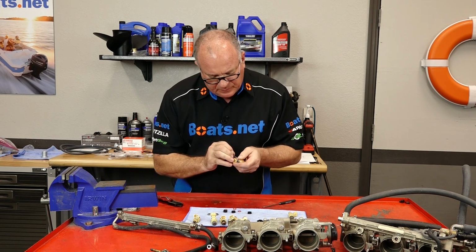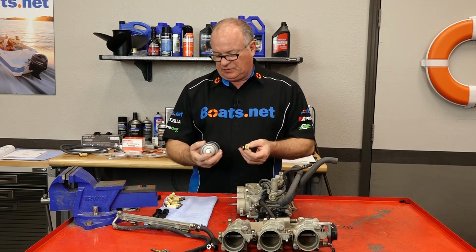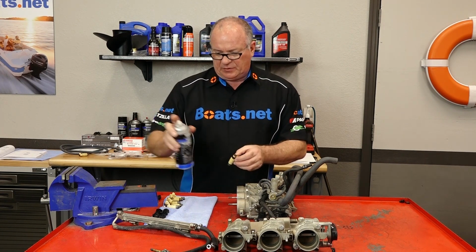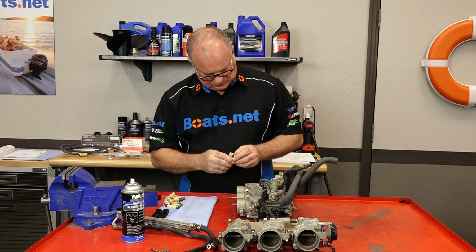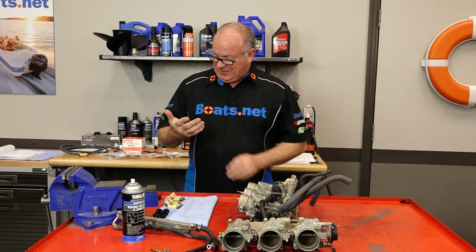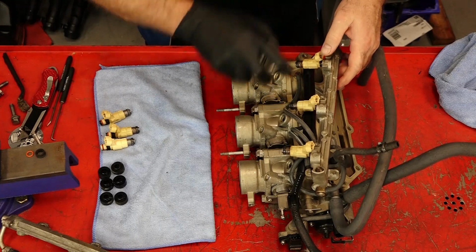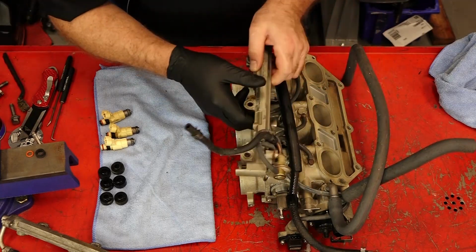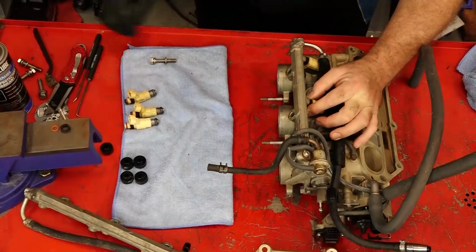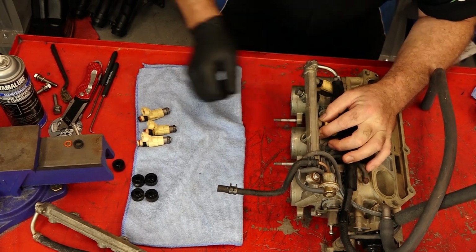and these little O-rings. All right, we're about to get our injectors installed into the fuel rail and the intakes. I want to use a little bit of silicone spray to make it easier for those O-rings to guide in. It takes a little bit of effort to get these in there. I think I'm going to use a glove the next time around. One more spray on the other O-rings. Then off we go. Get our spacers in. Just get it started.